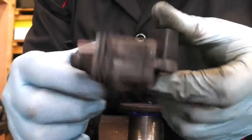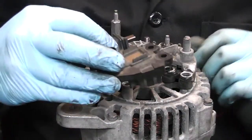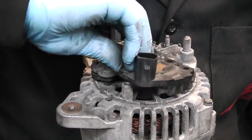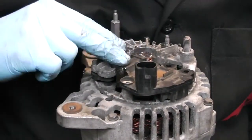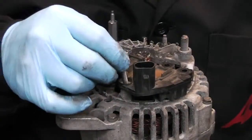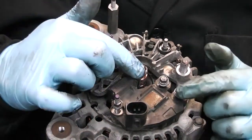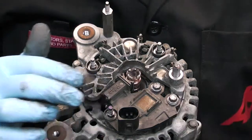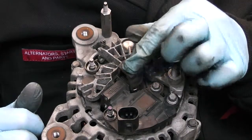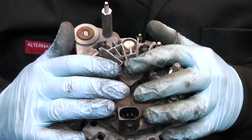Our brushes are changed. Now we're going to fit the regulator back onto the alternator. Simply pull the brushes back with your fingers and slide the regulator over the slip rings. Now we just put our three bolts back in where they were — one here, two there — and tighten them up. We have our three bolts tightened. This is the cap — what you do is just put the cap over the rail and simply slide it down like that. Then the cover goes back on, and the alternator is good to be put back in the vehicle.